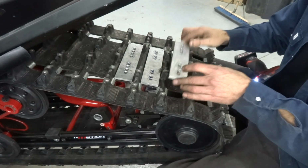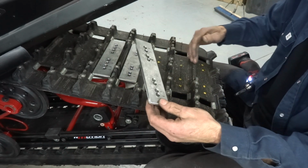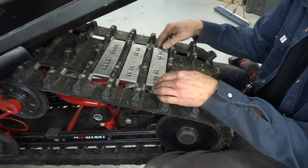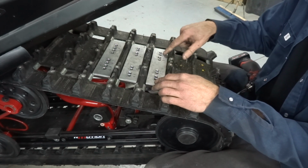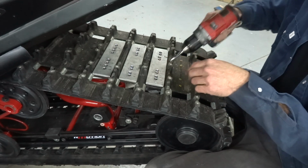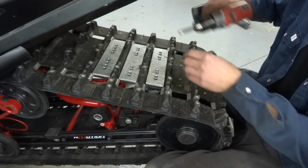It's a good idea to make marks before you drill. You could use your template and mark them all very carefully, so as not to make mistakes. So when you start drilling, you could see underneath. I see my mark, number 5's mark here, so I just have to drill where I see the paint. Less chance to make mistakes and drill the wrong hole.